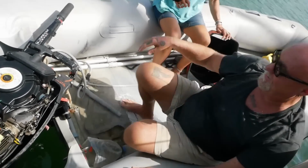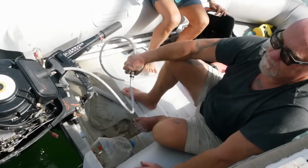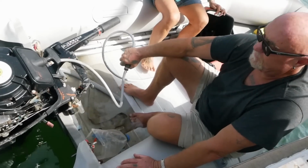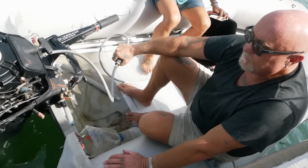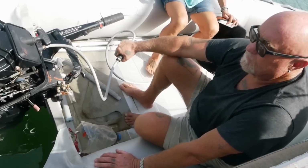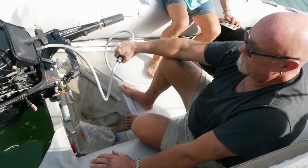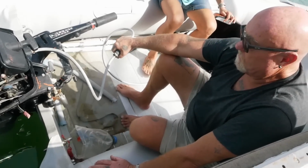Yeah. Squeeze the bulb first, of course, because we take all the fuel out of it. So we need to fill that up. And you can learn a lot by squeezing this bulb. It feels like it squeezes real easy, and then it'll get to the point where that float came up, and it should pretty much stop. You should be able to picture and feel that it's working.